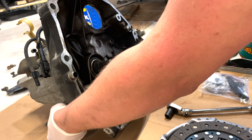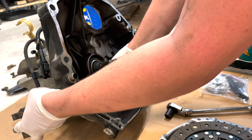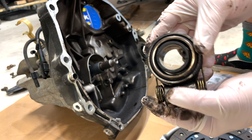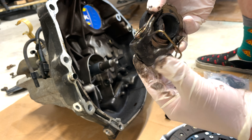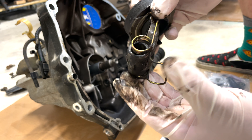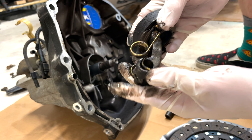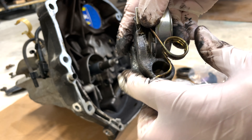We're going to pull this out and catch the release pin. You'll be able to pull it out just like that — pretty simple. I don't have a replacement spring unfortunately, but this one looks like it's in really good shape. It's not bent, it's still firm, so we're going to be able to reuse it. Pulling the spring tabs off from the sides and sliding the new bearing in place — that's pretty much it.